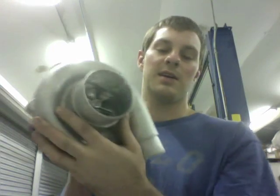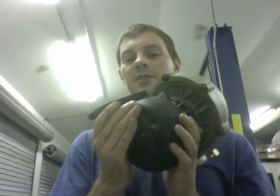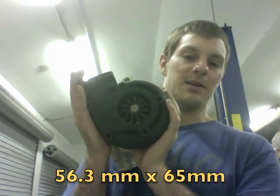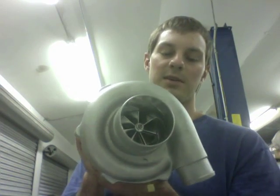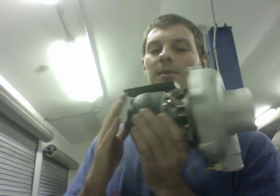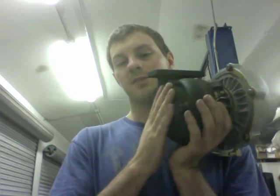The stage three shaft is 55 by 65 millimeter. And then you're going to use a compressor wheel that we label as a T4 compressor wheel because it originally comes on a turbo with a T4 exhaust housing. So with this example, a 60-1 compressor wheel is 59 millimeter by 76 millimeter — a little bit larger than the turbine side, which is 55 millimeter by 65 millimeter.